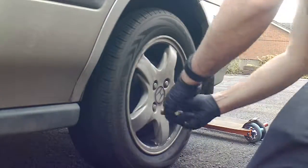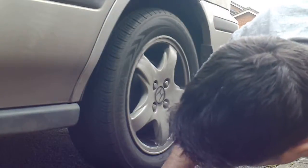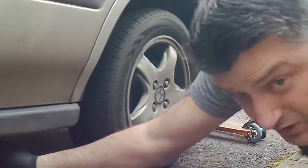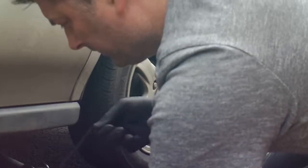Some good leverage — they've been undone. Underneath your car you should have a jack point. It's usually a solid bit of metal, something that's attached to the chassis. That's where you want to get your jack underneath. Make sure it's safe before you start jacking it up — get right on the lip. Make sure you jack it straight, because you don't want it falling on you when you're trying to do it.